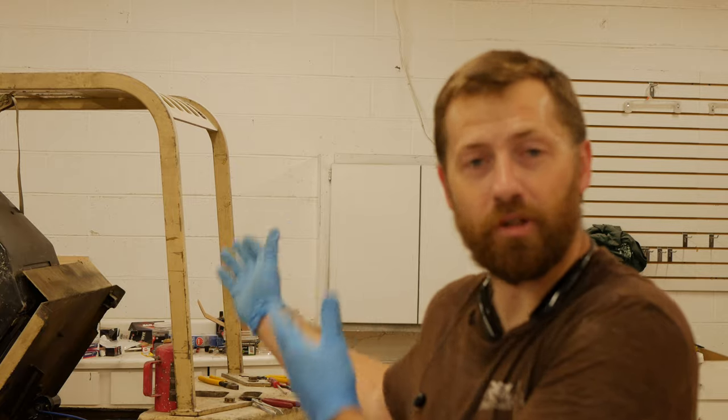So anything that you can remove that has the potential to chafe and ground out or wear through any kind of wiring, the better, because these wires will vibrate against each other over time, and if they're all looped around and dangling in a messed up spaghetti noodle kind of configuration, the spark plug wire itself is going to find its way to a hard edge corner or piece of metal, or they're just going to rub up against each other to where they rub through the insulator themselves, and then they're going to start creating havoc when it comes to ignition timing, being that one cylinder is grounding out and maybe two cylinders are grounding out between each other through the wire. So anytime I get the opportunity to shorten the length of the wire, it's relatively easy and it's cheap insurance. I do so, even on a piece of machinery sitting in my shop.